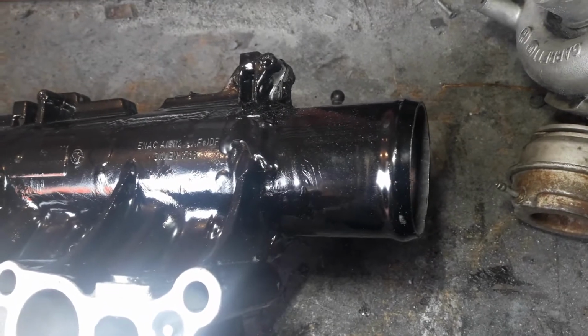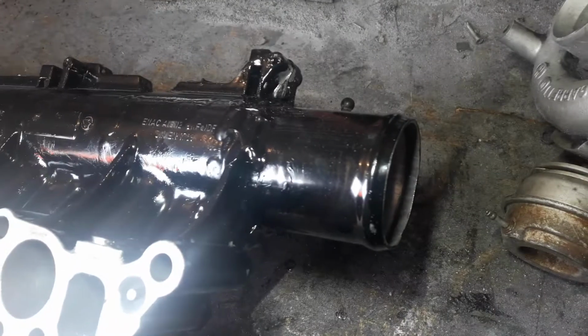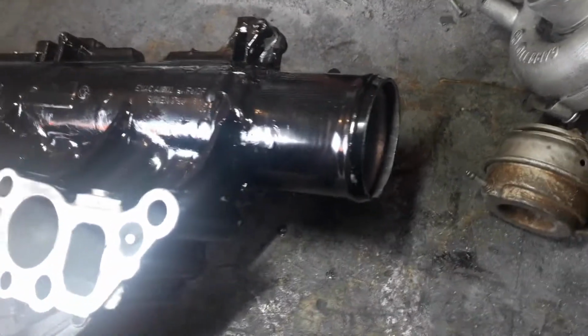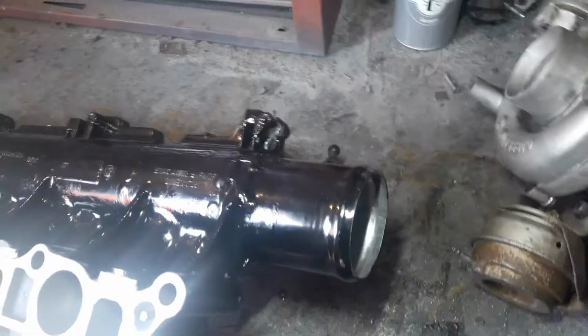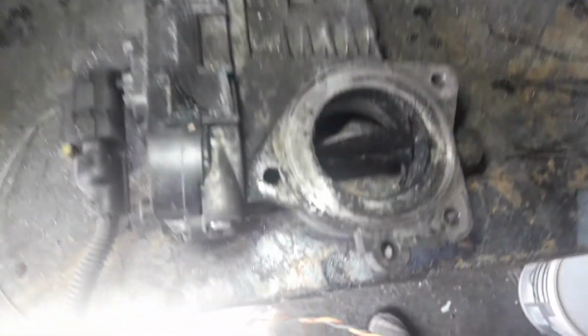And the other thing that it does is, if you ever have a turbo which runs away on its own oil, then obviously when you switch the ignition off, that flap will shut and strangle the engine. The problem that you get on cars which are running bigger turbos, like this one will be shortly, is that this is a real restriction. So there is the Anti-Shudder valve.